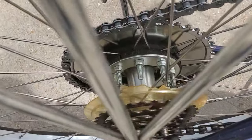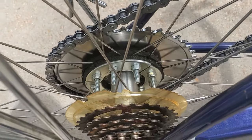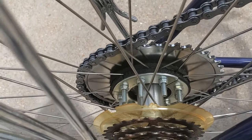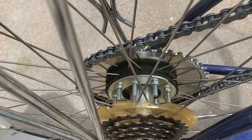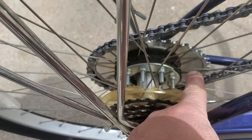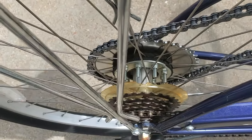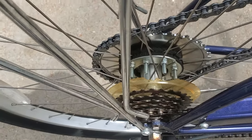This is just like the standard kind of swash plate is what I call it, squish plate. And it's not the absolute 100% best setup that can be done on these motorized bikes, but it works. And guys ride these for years with this configuration on here. You just want to every now and then check these nuts and make sure that they're not backing off and getting loose. They are nylock lock nuts on there. Okay, there's nine of them.